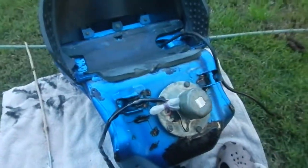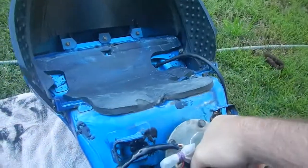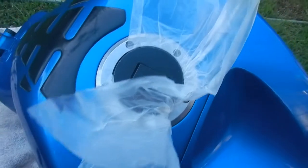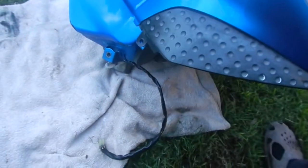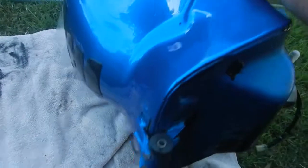One thing to note if you've checked out the KBS website - he does say that with a 4 litre tank of this stuff, just let it flow around and do it nice and slow so you can feel where the sealant actually is. But with the 1 litre tin you can't really tell where it is, so you pretty much just have to go nice and slow and make sure you're getting it everywhere. You'll see the consistency when you pour it in. With a car fuel tank, with the internal baffles and stuff, it's probably a little bit easier than a bike fuel tank because they tend to be odd shapes.